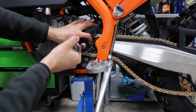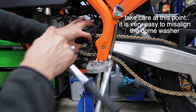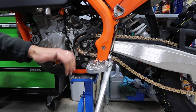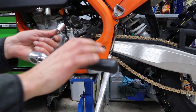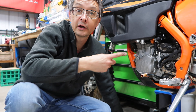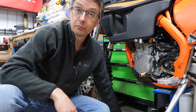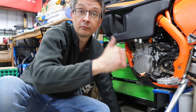You've got to get the washer centered in that bolt. Most of that tightening you can just do here against the engine if it's in gear, and then once I get it all back together properly I'll tighten it while sitting on the bike just to give it a bit more of a snick together. Then adjust your chain as per the recommendations and that's it, you're done. Now I've got the bike back together I can get on with the prep of my luggage and things, so stay tuned for more videos on this prep. Thanks for watching, see you in the next one — bye for now.